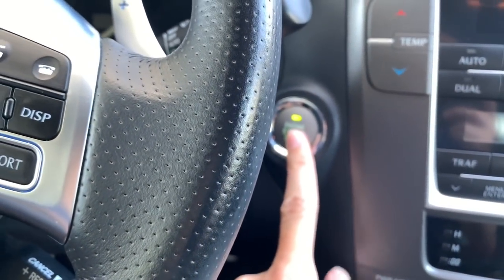I'm going to set the rear tires to 26 to 28 PSI hot, and when you do that the TPMS light will turn on. Next up, you are going to start your car.